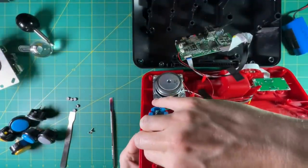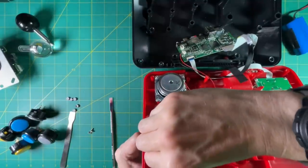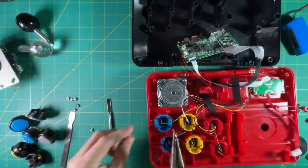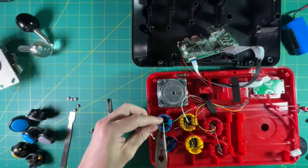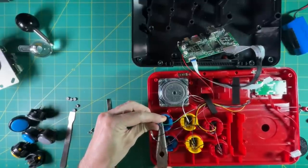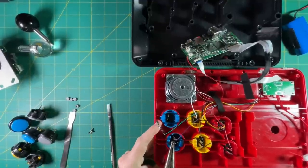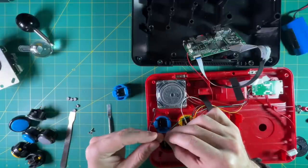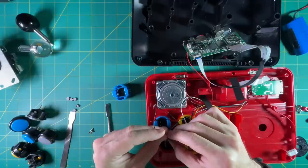Now these cables are really snug on there. I was not able to pull them out by hand, so I had to use some needle nose pliers. But even then, it's hard because you have to be a little bit forceful, but you also have to be careful because, as you can see, when I pulled one of them out, the black wire, which is the ground wire, came undone from the connector. And so you can just see it hanging loosely there. I'm going to have to reconnect those later, and I'll show you how I did that. As you can see with this wire that came out, I tried to push it back into the connector. It really wasn't working, so I ended up having to use a different connector. We'll work on that in a bit.